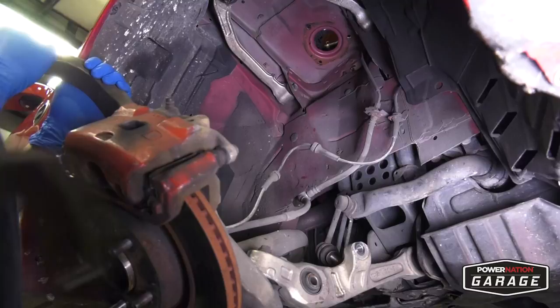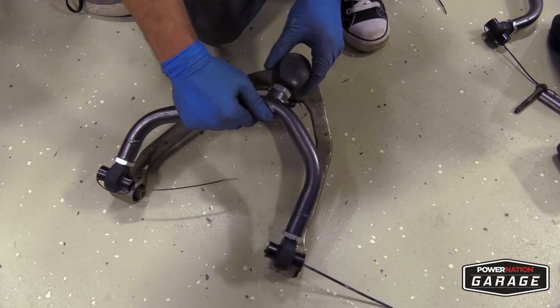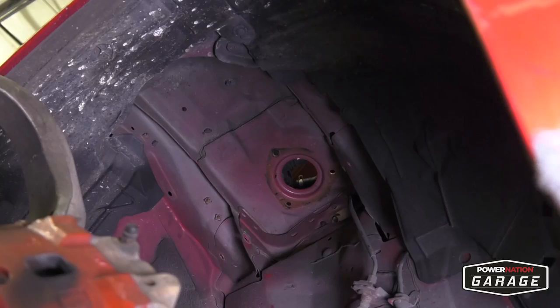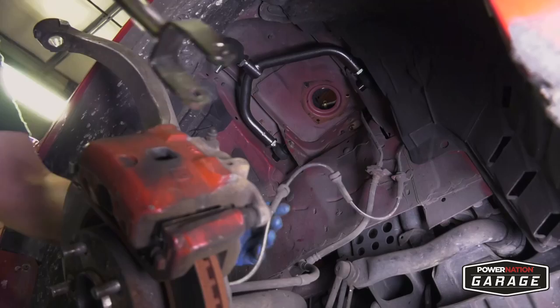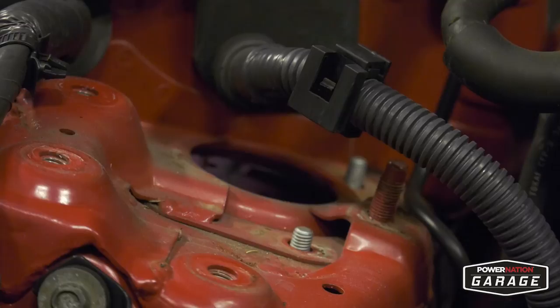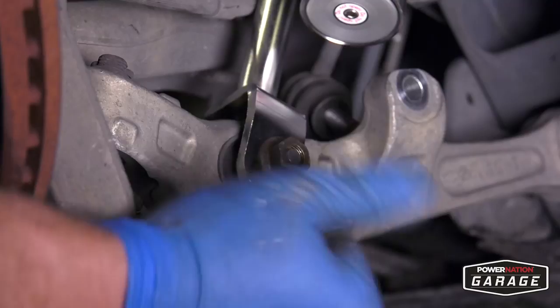Use a wrench and socket to then completely remove the upper control arm. Once out of the car, adjust the aftermarket control arms to be as close to the OEM length as possible. This will need to be professionally adjusted once it's back in the car to get the caster and camber to where it needs to be, but you might as well get it as close as you can while you're putting it back in. Reinstall the new adjustable upper control arms the same way that you removed them. Install the new coilover shock by slipping the top end first, followed by the bottom end, installing the mounting bolt on the lower control arm followed by three nuts on top, holding in your high performance aftermarket coilover shock. Now you can go ahead and reattach your brake lines to the brackets and tighten up the upper ball joint.